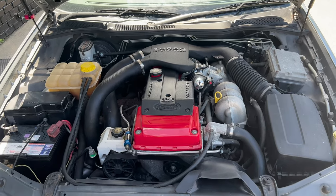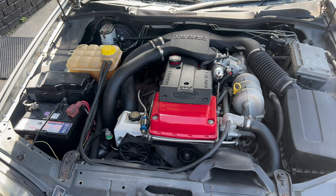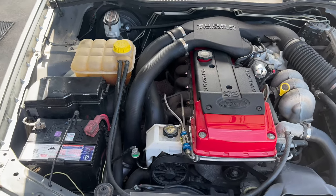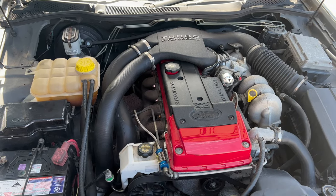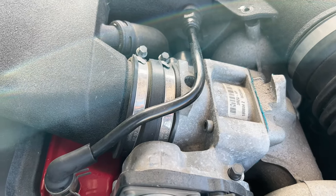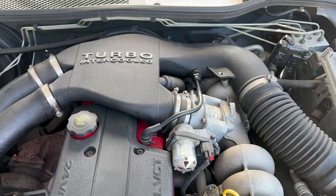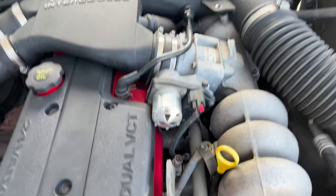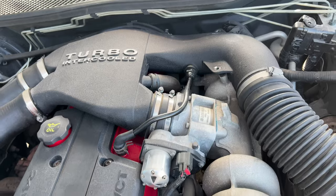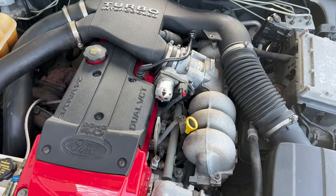So our main plan of attack here is going to be remove this intake pipe to the turbo, hook up the boost pressure checker, which will inflate all the cooler piping to whatever pressure I desire with the reg. Most likely culprit is probably going to be this silicon joiner here that goes to the throttle body. The underside of that will probably be popped off or split. That's really common. Next thing most likely is possibly the paper, cardboard gasket for the intake manifold to the head. They also blow out. I used to replace them all the freaking time when I worked at Ford.